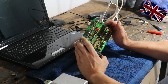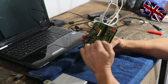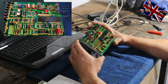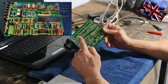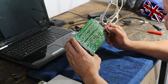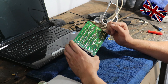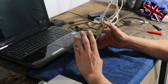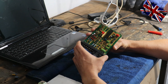This is more or less all you can change concerning capacitors. In addition to that, check the soldering points and heels of all capacitors for cracks. If you find one broken, just give it a touch-up soldering. To redo all the soldering points is too much trouble, if you ask me. I would say: change the capacitors that tend to break, check all heels of the capacitors for cracks, remount the unit into the car, start praying to all gods and hope it will work. I'll show you that picture of the capacitors again which need to be replaced.